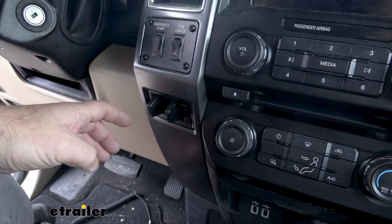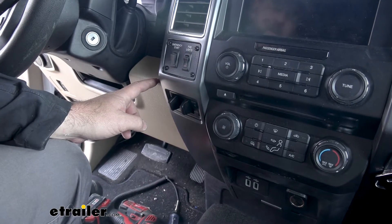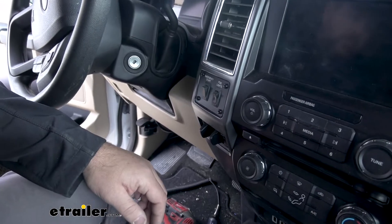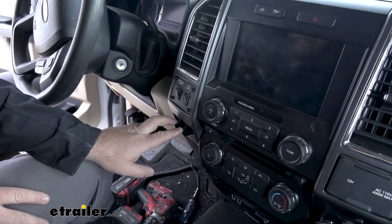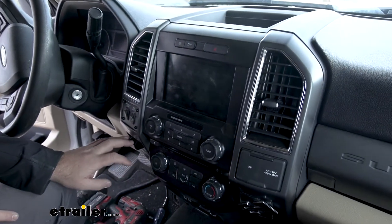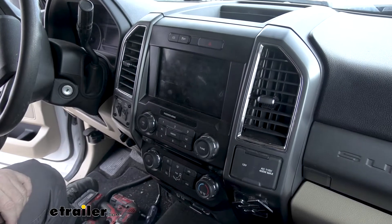You're going to have a bundle of wire that comes in your kit that'll come from your monitor light, that you would run underneath the chassis to the back and hook it to the blue wire coming out of your plug or to the brake wire. In our case, we're not going to have to do that because we have our brake controller here. So what I'm going to do is pull the center of the dash off, get to my brake wire going into my brake controller, and tie into it right here — it's going to save me a lot of extra time.